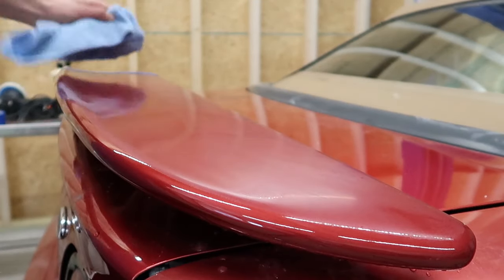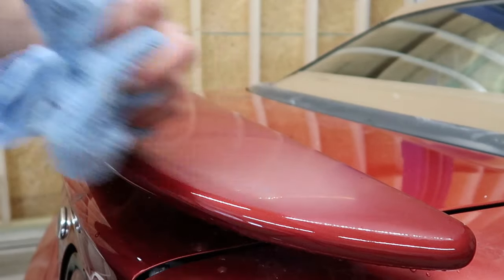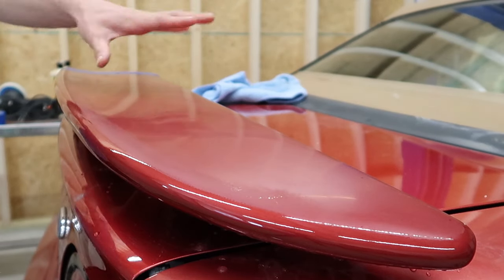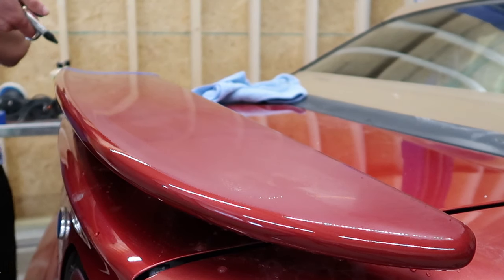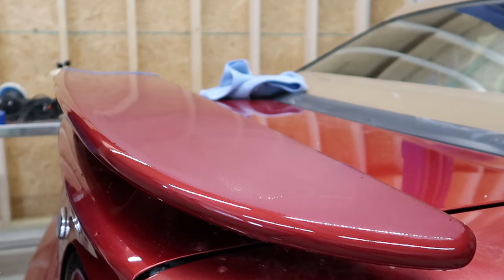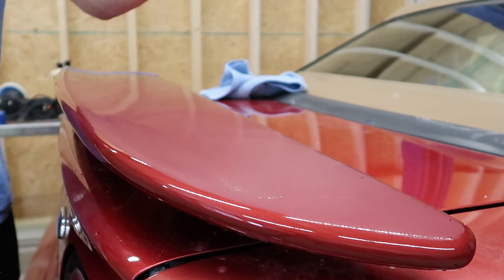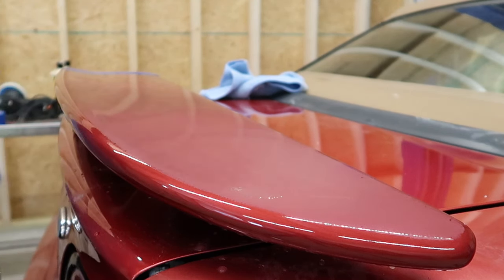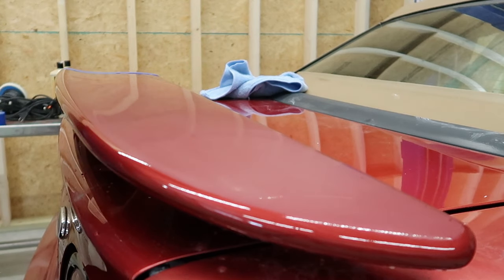If you're gonna be polishing it out, you most likely are gonna be using an air compressor to blow out the pad. So I'm gonna show you a trick real quick while I'm trying to dry this to get an idea. You can see that there's some areas that still look wet. You just hit them with the air and they're gone. So now you get a good idea of exactly what you're looking at. And what I'm looking for right now are areas where it looks like it's not uniform and the scratches might be a lot deeper, and I need to do the work now to try to remove those before I get to the polishing process.